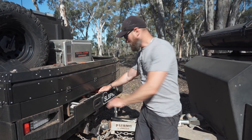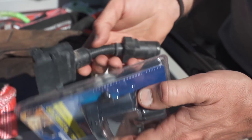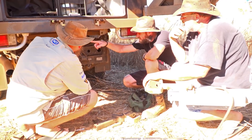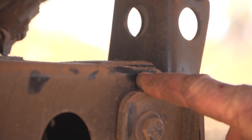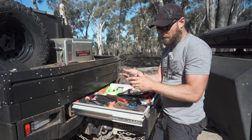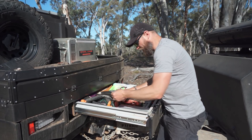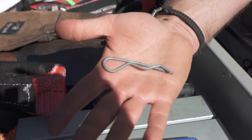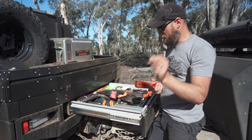Spare bits and bobs: it's good to have a spare trailer connector and also an adapter, because what if your vehicle becomes incapable of towing or something happens to your tow assembly — I've seen one cracked on both sides, at the receiver, on the top, on the gussets, cracked in five places. Most people have either the flat or the round plug, so always carry the opposite to what you actually need. Also good to have a spare pin for the big pin that holds the trailer tongue in. And a recovery hitch — if you drop it in the sand things can get lost real easy, so keep a spare one.